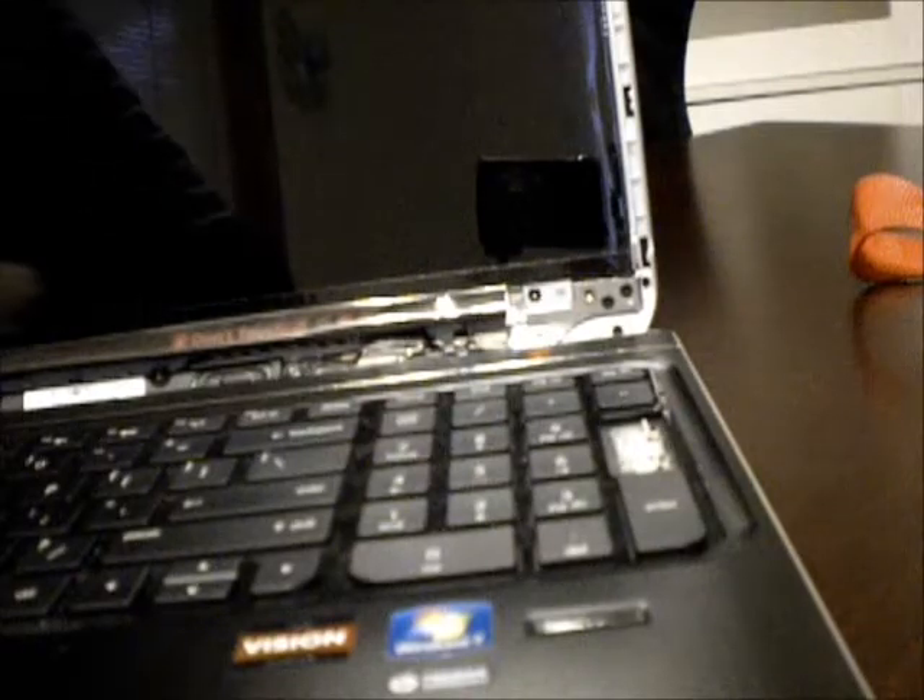You don't want to pinch the wires — make sure there's a nice free play in there. Start reconnecting the mount to the frame. Press it down over the wires first to make sure those are in, then start working your way around. If you see any dust particles getting under the screen, just back it up before you do anything with it.